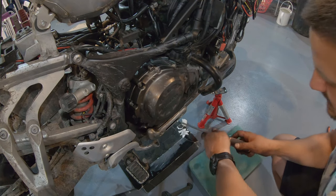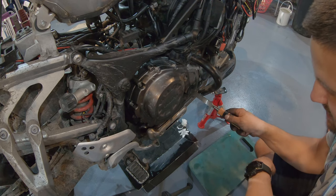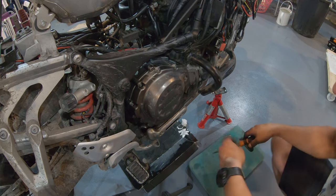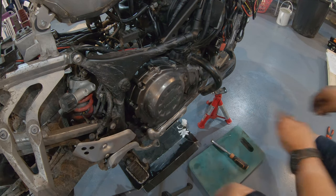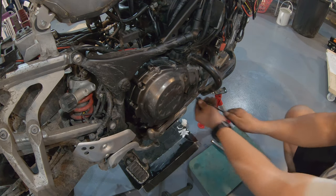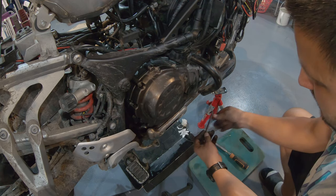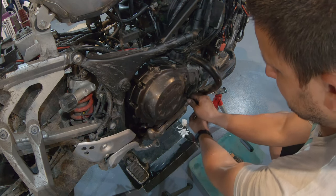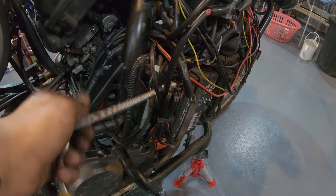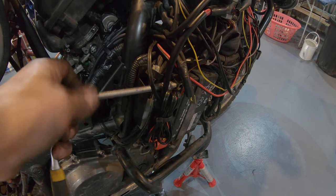So remember to put the plastic cover back on. You can use a coin or something, and just there is a seal inside. Anything flat will do. Tighten it by hand, and then there is this little bolt that you need to put back to the side here, which again probably 10 Newton meter or less by hand. You need to connect the negative pole of the battery. Remember that we left it in again.